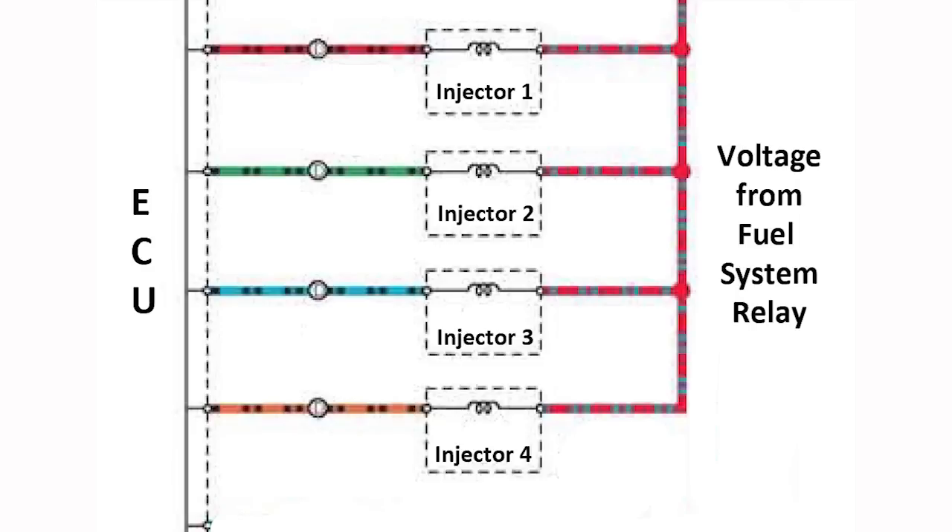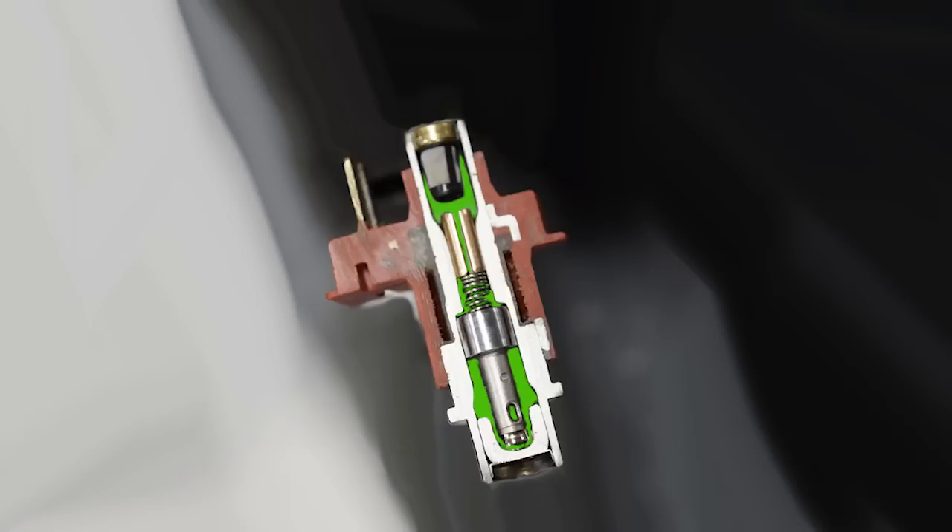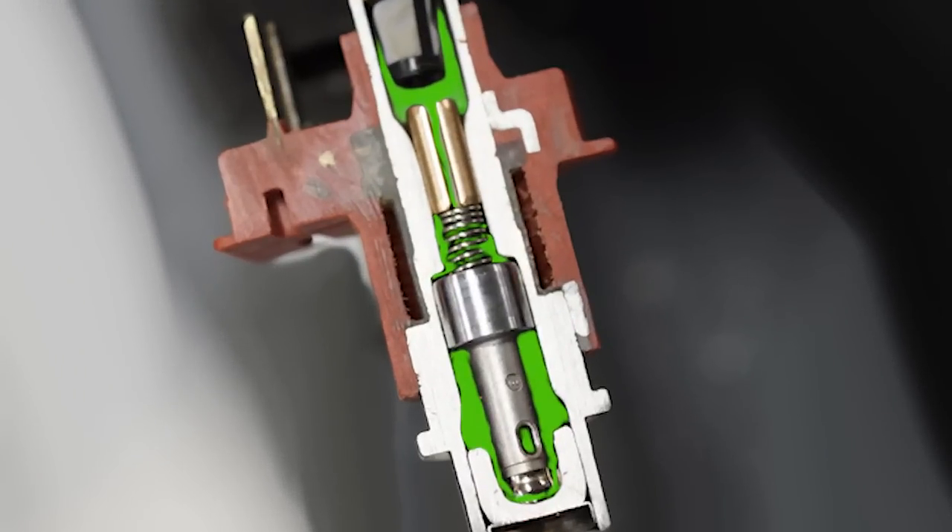To eliminate a wiring problem, test the input voltage and the ground side wires and connectors with the usual electrical troubleshooting tests. Now it is possible for an injector to pass all these tests — resistance, peak voltage, everything — and still not be opening and closing, not making that clicking sound. This would most likely be caused by the injector clogged with fuel residue or some other contamination, not allowing the plunger to move freely.